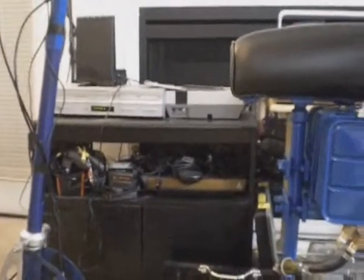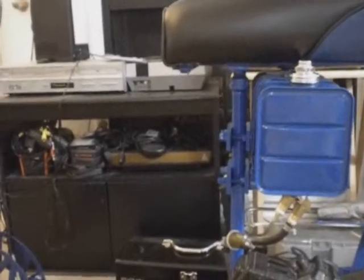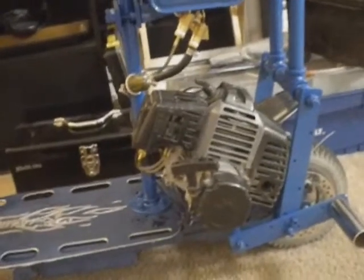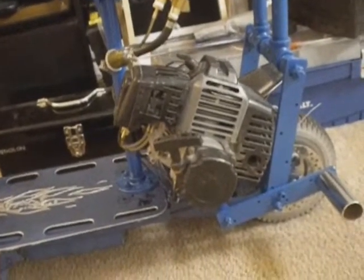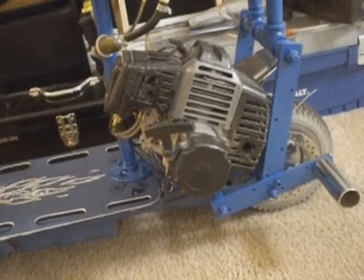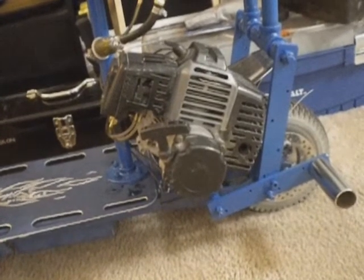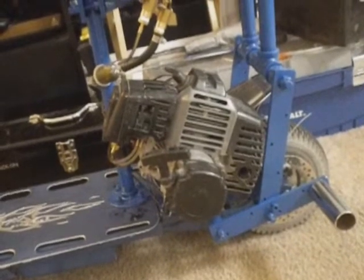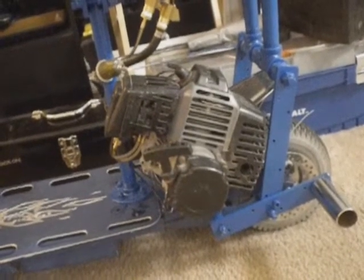These scooters, well, after riding on it for a few minutes, it's a little tiring. I'm not going to add lights to it or anything, nothing like that. If I ever did, it'd probably just be like a bicycle light set. You can add it. There's like a little voltage regulator it comes with. The magneto will provide it. It's not very much power. It's at 12 volts, and you can hook it up, but your lights won't be that bright.